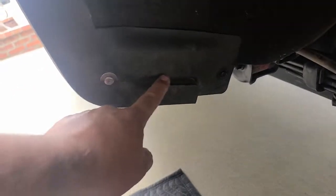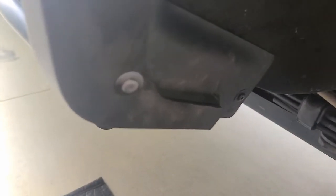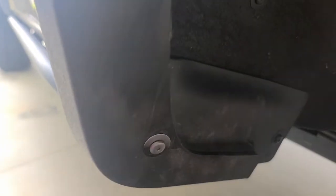Most of the time, you can see the contact usually happens down in here, and when it catches here is when it causes damage. If you take a close look, you can see where the rub is. I got lucky — it actually polished that washer and bolt pretty good, but you can see it was just a sliding rub. It didn't quite catch in any instance, so whatever the configuration, where the axle sits right now just happens to favor this side and doesn't cause major damage.